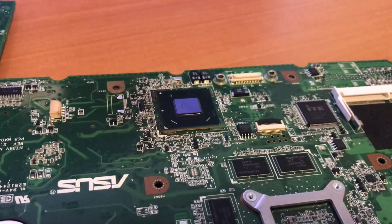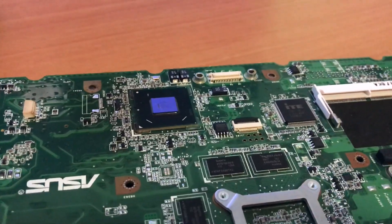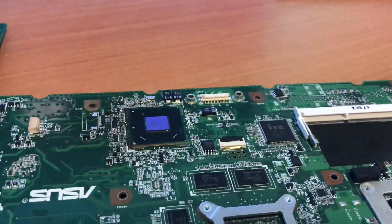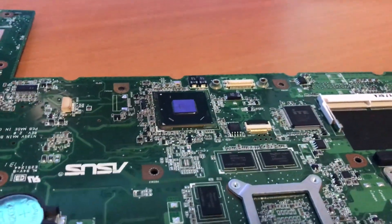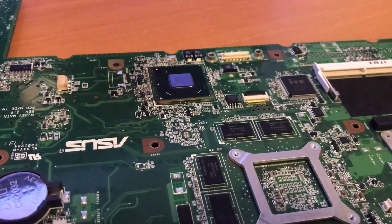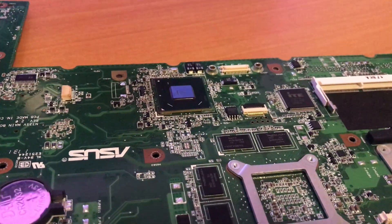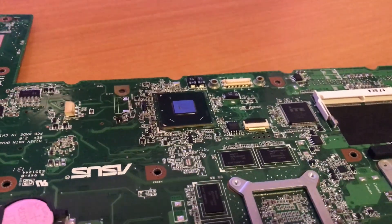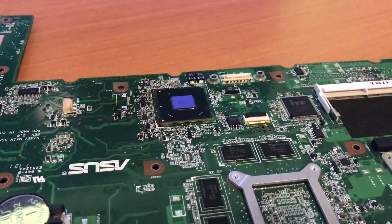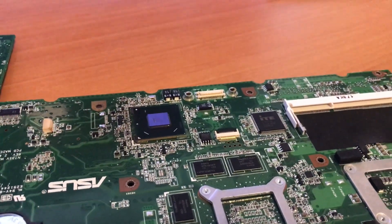The chipset supports your CPU and you can easily Google it — it gives a list of what CPUs are supported. But even that does not confirm it will work; there's a chance the BIOS will say no to your new processor. So check — this is an ASUS motherboard — head over to the ASUS site, check for this motherboard and your laptop type, and see what BIOS updates are available and whether any update added support for a certain processor.